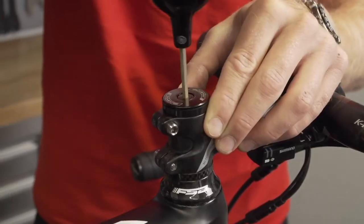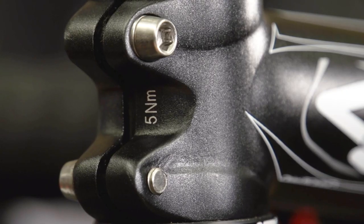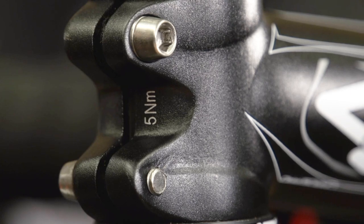You should check that all the bolts on your bike are correctly tightened and not loose, and pay particular attention to the headset, the stem, and the handlebars. If these are loose, your bike could be dangerous to ride. To make sure they're at the correct level of tightness, we'd recommend using a torque wrench — it's the only tool for the job. The specific torque needed for each component is usually written on the side of it. You can check if your headset is loose by turning your handlebars, putting on the front brake, and rocking your bike forwards and backwards. If there is play in the headset, you should be able to see it. We've got a video — link in the description.